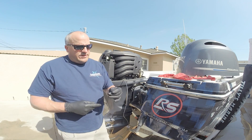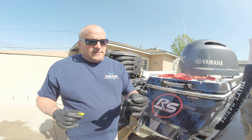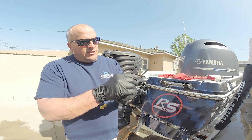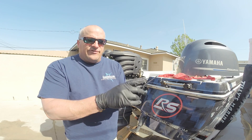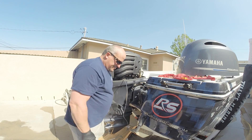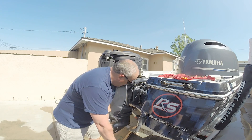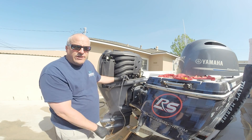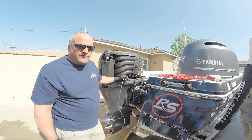When you fill up your oil, there's not really any marking on the dipstick to show exactly the right amount, but it has two holes — one here and one here. Ideally your oil should stay between those two; I usually fill it just a little bit past half, which gives about six quarts. This pump will just keep pumping oil out until it loses suction or there's no more oil. You can tell there's no more oil because the line will run clear instead of black — if it's black and nothing's flowing, pump a few more times.